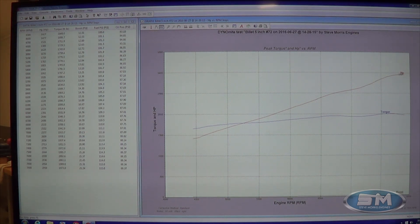The engine will rpm more, but I don't like to push the dyno stuff past where it rolls over — it's kind of a waste of time. This is a 600-plus cubic inch motor that isn't made to run 9,500 or 10,000 rpm anyway, and it's a full street motor. At 7,900 rpm we're looking at 2,959 hp and 1,973 foot-pounds of torque. My dyno gauge is reading 21.5 pounds of boost while the Holley with its map sensor is reading 20 pounds — so we'll call it 20 pounds.